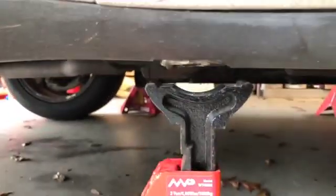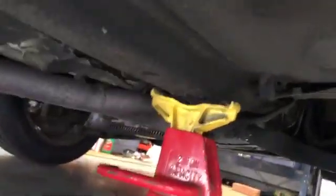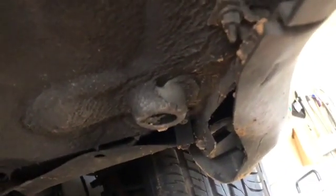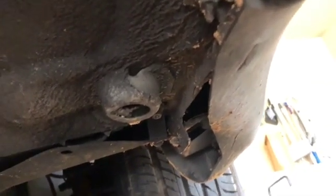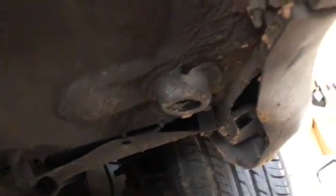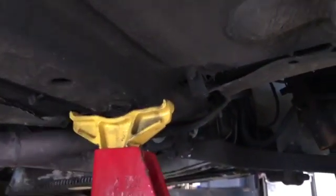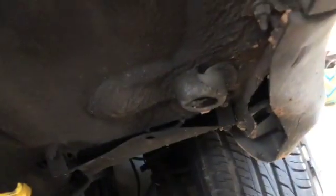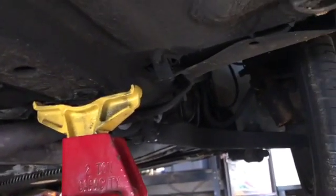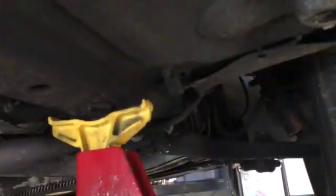As we go, we're still going to go up a little bit further, but as soon as I can, I like to get the jacks positioned underneath and ride up with the car. So I'm using the frame rail right there. There's a lot of controversy on using that puck right there. I've used it in the past and it's been fine, and I know several guys who have used them and never had an issue. I definitely don't jack from there, but as far as setting the stands on it, I have. But after reading a bunch of guys saying that will collapse or bend your floor pan, I've opted to go for this frame right here. Just as good, and easy. To me, the stand fits a little bit better on it.